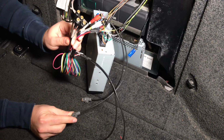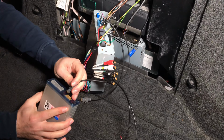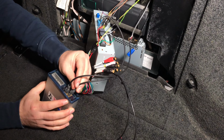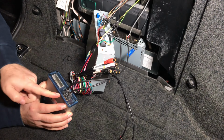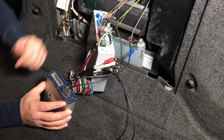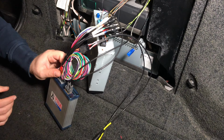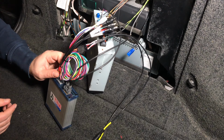You got two cables. The cable that goes back into the car, you're going to connect in here into the other one. So this is that goes back into the car. In this one, you're going to connect the navigation side. This cable that goes to the navigation. So keep in mind, the inside one, you got camera. So this goes to the screen and this goes back to navigation. Plug in the main cable and you're done with your installation. Go to the front, press and hold the nav button and make sure the interface activates.